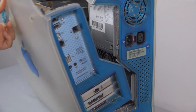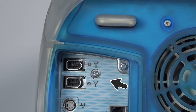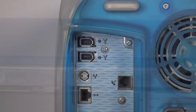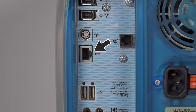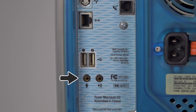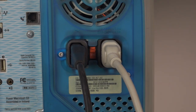There's going to be a bit of faffing around with the internals later on. For now, let's look over what we have on the outside, starting with the business end. On the back are two FireWire ports, and above those is a lever — pull this out and attach a padlock to lock the access door to stop miscreants getting inside. Below that is the curtain call for Apple Desktop Bus for older keyboards and mice, an optional and now completely redundant modem, 10/100 Ethernet, two USB 1.1 ports, and audio in and out. Next to the power in, there's also power out, typically used for a monitor, which knocks the plug socket requirements down from 2 to 1.